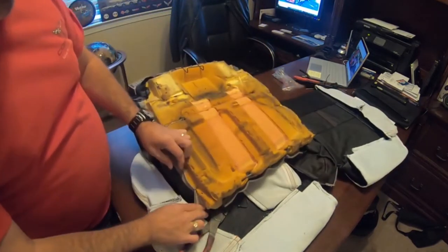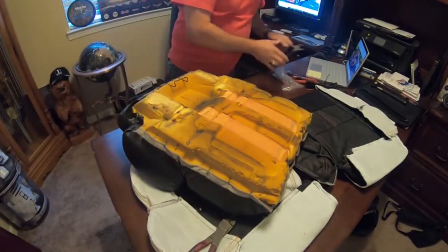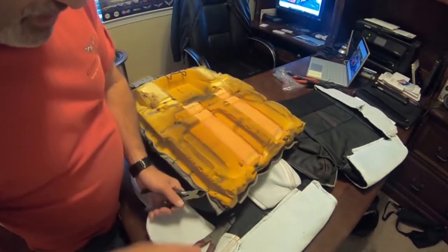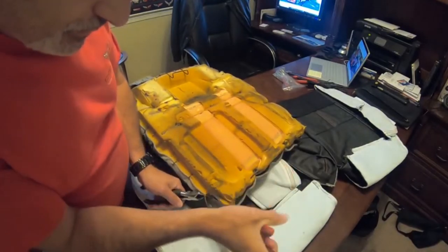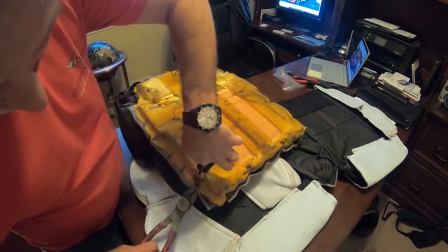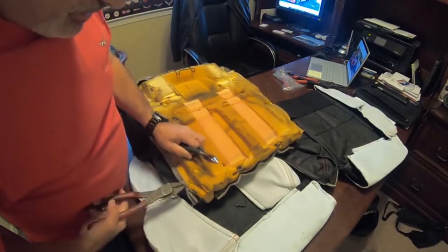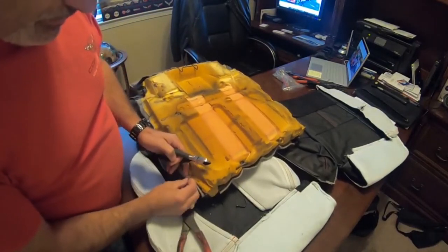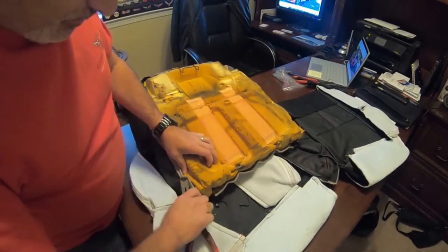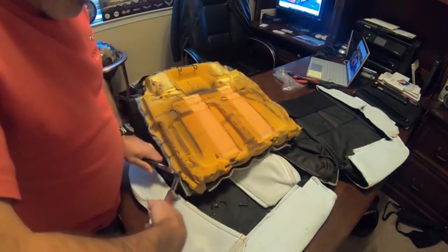Okay. All right. So now what we've got is the hog rings that we need to start taking out. Usually what I do here, depending on how they're put on, we might be able to sometimes just twist these free. If not, we've got to use two of them, a pair of pliers, or two of these cutoffs here to twist these hog rings so you can get them loose. And this one's just being ornery, but we'll get it. If you've got cutters that are strong enough that you want to just clip these, you can, because we're not going to reuse them.